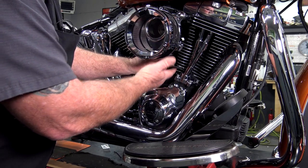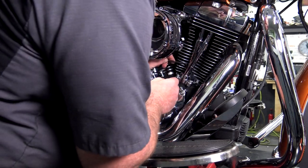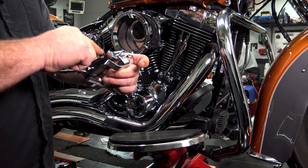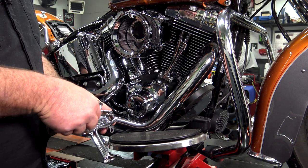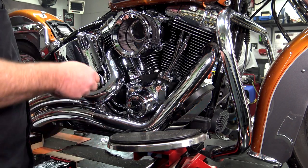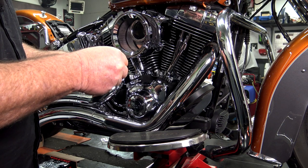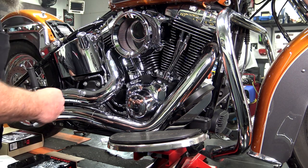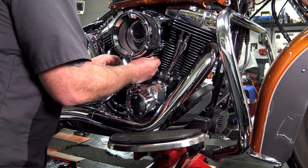If you have an air cleaner getting in your way, you may have to take the air cleaner outer cover off to give you a little more room to see. These two back ones can be a little bit of a pain in the butt. Pull up the tappet cover here — you'll see the bolt in the front goes through the tappet cover accent into a bracket in the back, and that nut is welded onto that bracket. Just take an Allen wrench and take the screw out. We want to take the bracket off. From here we're going to slide this into place, take the two bolts we just removed, and add a little blue Loctite to those, then put them right back in.